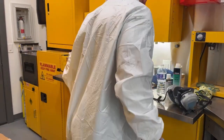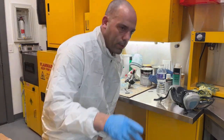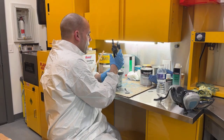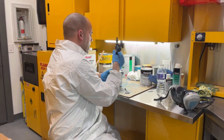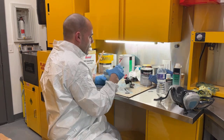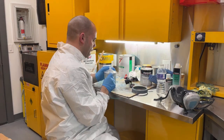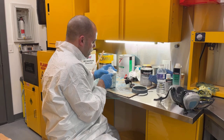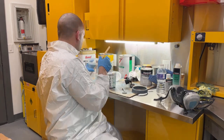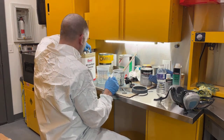That's the first coat of clear on the quarters and the back panel. As you can see, I ran out right towards the top of this panel. If that happens and you're putting clear on, you don't have to freak out and run around like an animal. You've got to work quickly, but you have a couple minutes before it starts setting up on you. So if you're within a minute or two and you start blowing the clear on again, it'll blend right in, you'll be fine. When I was younger, I'd run around like an idiot, throwing stuff, trying to get clear mixed as fast as possible. And in all reality, it really doesn't matter.